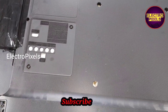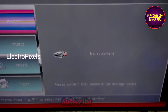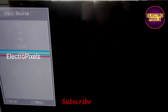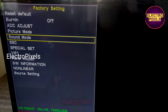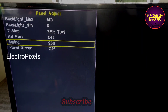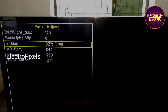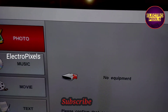The installation is complete. We put all screws back into the TV. To correct the LVDS mapping, we enter service mode using the code: Input 2-0-8. In service mode, go to Panel Adjust and correct the LVDS mapping. The LVDS mapping is now adjusted and the picture is displaying correctly.